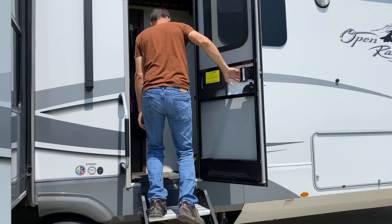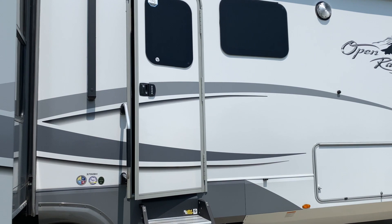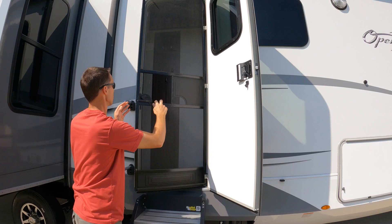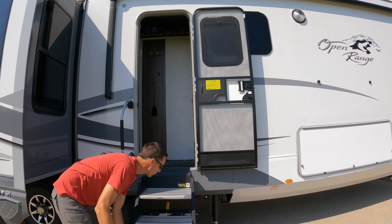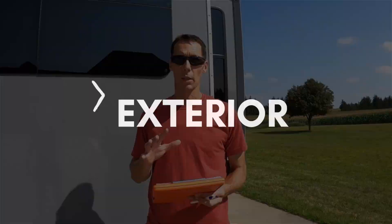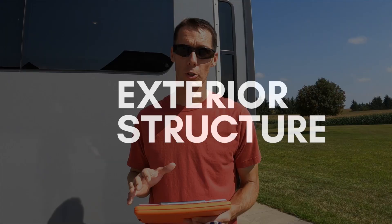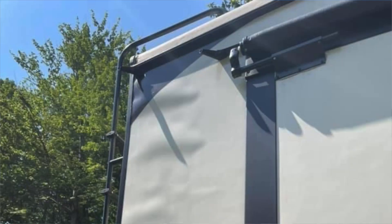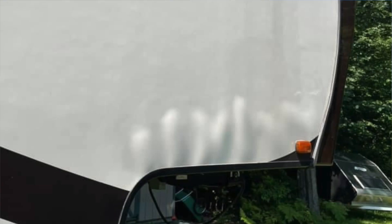Come over to the main door — open and close it. If you have to slam it to shut, that's not good; it might need a little lube in the latch or hinges. Check the screen door and main door bow, and verify the steps go up when they latch and the door closes with the steps in transport position. As you go around all the doors on the outside, check the caulking — make sure everything is smooth with no gaps for water to get behind into the RV. When checking the exterior structure, look at the fiberglass: it should be smooth with no delamination, which appears as bulges or bubbles indicating water damage.